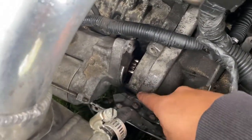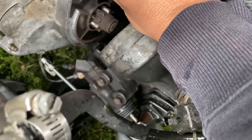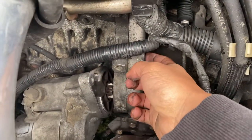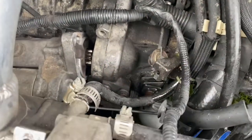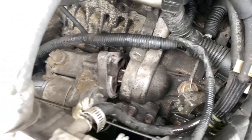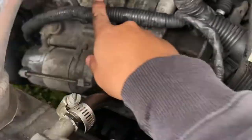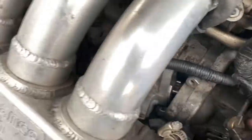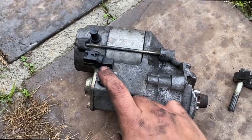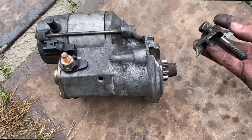I took off the reservoir already. You can see it right there — that's where it broke off. I think I'm going to need a bolt here. The only one holding it was the bottom one, but that one's already off because the housing is broken. You have this wire harness that goes there, and it has a bolt and a plug. I removed that — it's a size 12. This is the plug I was telling you about, and this is where it broke off.